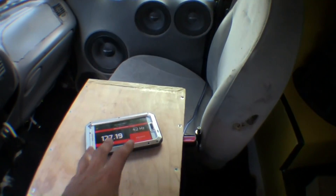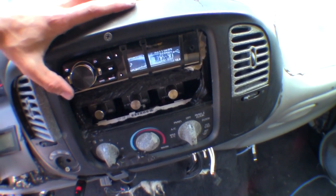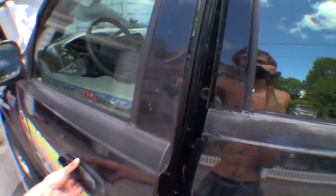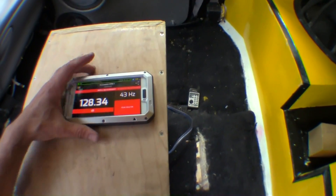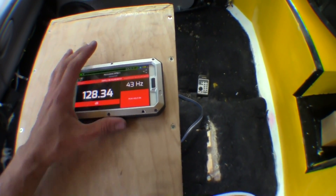So let's go ahead and take the seats out and see what's going on there. Let's go right back to our 10 to 80 sweep — I think that was track one. We haven't registered on the meter yet because it's so low. We registered at 25. Now we registered back up again. That was definitely definitive right there. So without the seats, it's 43 hertz — it raised exactly one frequency. But what does this translate for helping us out? Why do I even want to know this? Let me disconnect my Bluetooth and we'll tell you a little bit about what's going on.